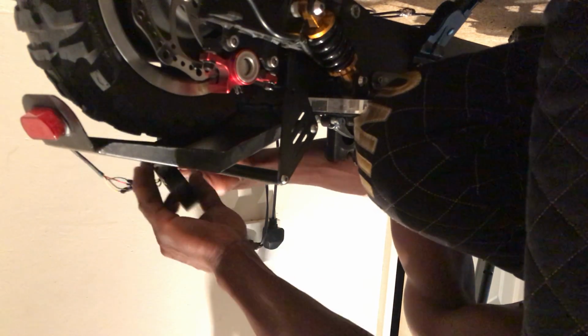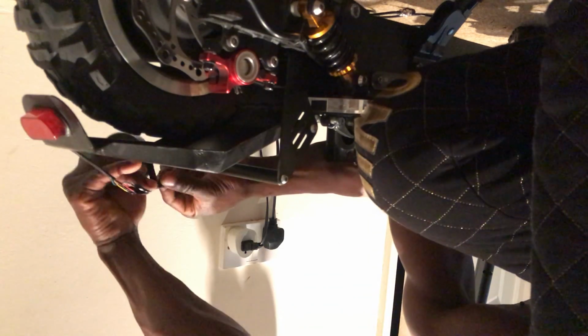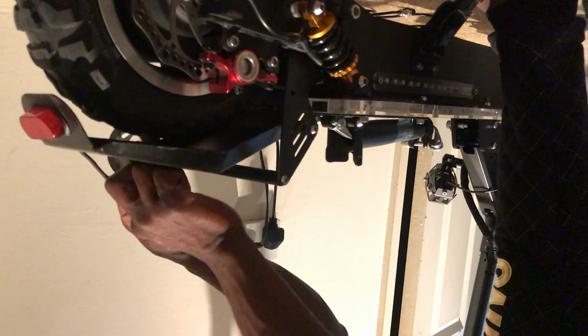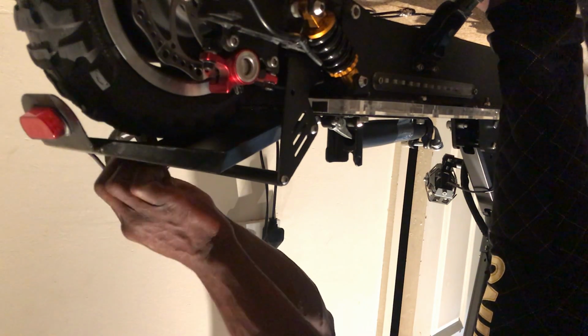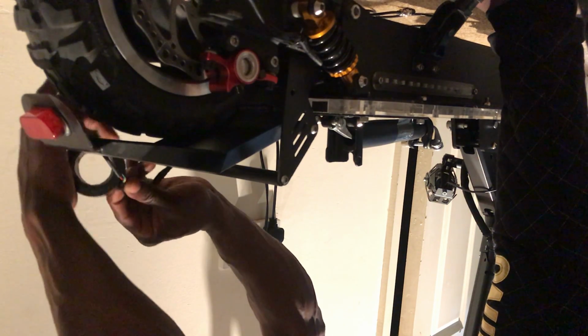these wires together as a whole unit, just like the way it used to be when they were in the actual coating. So with that one is good. You just have to put the insulation tape on it and keep moving it around, and you just bind all of them together. And you can do it a few rounds, so that way you know that you've got a lot of coating on that, in case anything happens, a tire is maybe grinding or something, it doesn't really affect the wires.